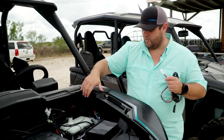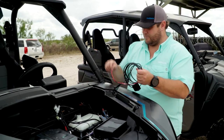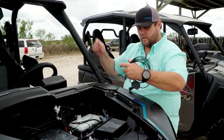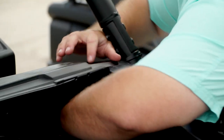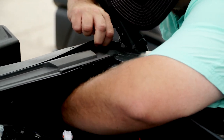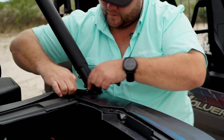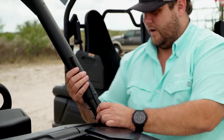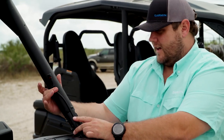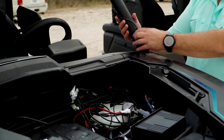What we've done is we've removed the firewall here and the hood. And I'm going to be able to run this power cable right into that plug and mount it right here on the roll cage. So we've got the actual end that's going to plug into the Garmin unit here and we can fish it up through the firewall of the machine. I'm going to bring it right up where the roll cage comes through. We don't need a whole lot of cable here, probably just enough to get to the mount of that Tread unit right there.